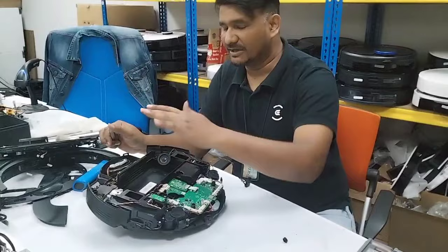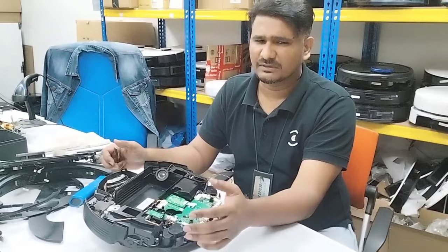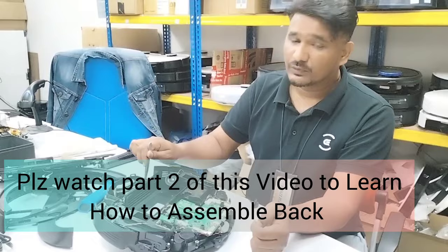I'll replace both left and right sensors because I don't have enough time to test in between — I'll fix everything back and then test. I think both left and right need replacing due to the water inside. The vacuum fan looks okay — not very rusty, just the screw became rusty, and we can replace that. So we will replace left and right anti-drop sensors and then test again. Thanks for watching — thank you very much.